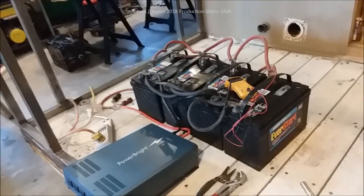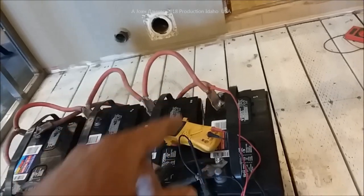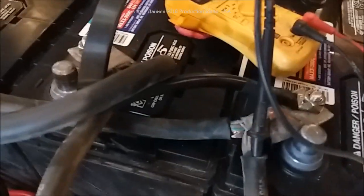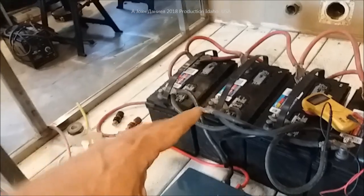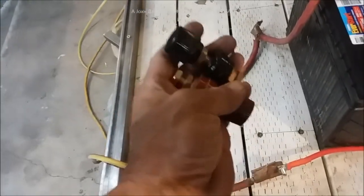Other than some new batteries - look for a video on that, I tested about 12 of those batteries and finally found a good set, good brand. Here's the setup: those are the batteries, this is the old jump links I made years ago, this is a 2/0 cable and that's how they're going to be put together. You pull from this end for the positive and from this end for the negative. There's the cable going to the inverter - it's 2-gauge. These terminals are good for 330 amps, advertised as 300 but the calculations on the post itself show 330 capacity - they're 74% copper and the rest is brass.